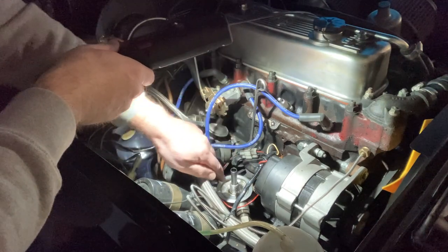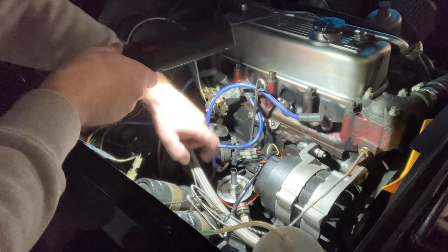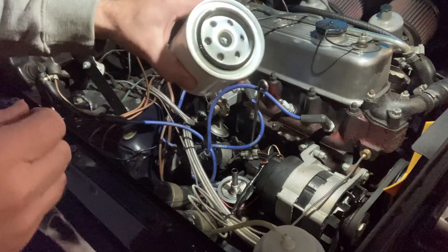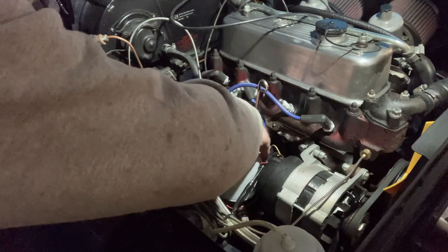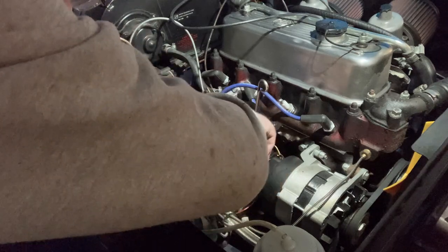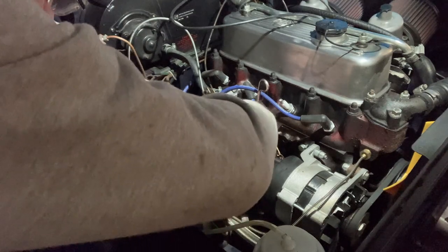There's the centre pillar that goes up into the filter, and here's the thread piece that you've got to just wind down gently. This is the rim that the rubber seals on. As I said, we just need to put a little slick of oil on it just to make it really nice and tight. Just oiled that up and drop it over. You've got to try and make sure it's square — you'll feel an immediate tightness if it's not. It spins on nicely if you've got it square. Just do that up hand tight, and then you're ready to start filling.